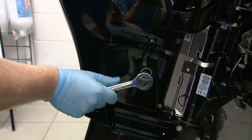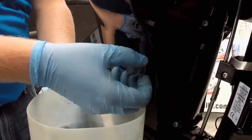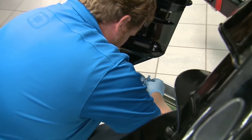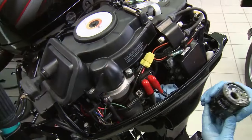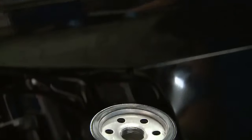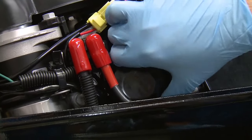The main difference of 4-stroke versus 2-stroke motors is the need to change the oil in the engine itself. It's easily done by unscrewing the plug and catching the oil. If you can turn the motor, you can attempt to make it a less messy proposition, though I haven't quite mastered that myself yet. When empty, replace the plug and move up to unscrew the oil filter. Take your new filter and with a finger dipped in oil, lube up the rim before screwing it on.